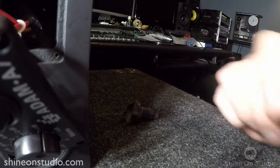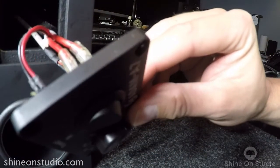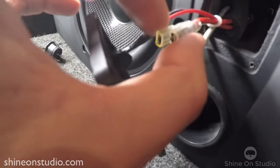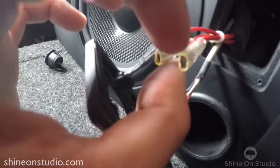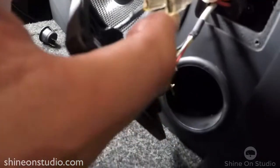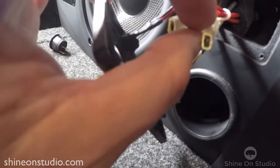Take your time with that — it's really important to get that off in one piece and away from the switch, making sure that you don't damage the LED lights which are still glued in right here in their original casing. Underneath the casing are just these two wires — they're plastic coated and should be zip tied back here. If not, be very certain to mark which one is the positive and negative, or the top and bottom. I just put a black Sharpie mark on the plastic casing on the bottom one, so I know that one connects to the bottom terminal.